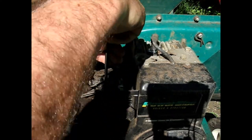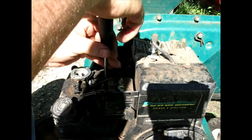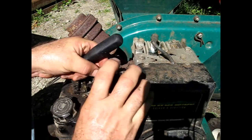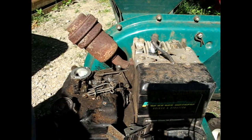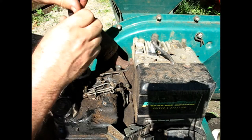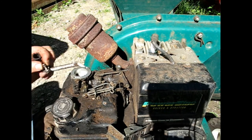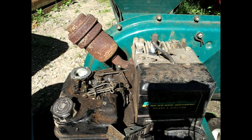We'll take that, tilt it, and get that lever off. There's a kill wire here — we'll just let that dangle, it's not going to be in anybody's way. Let me get that screw out before I lose it, and let's figure out where the other screws are. That muffler is still a little hot from testing. This is the PCV hose — it's got a little crack in it, so maybe a little RTV or silicone would help seal that up. You just don't want unfiltered air going into your carburetor.